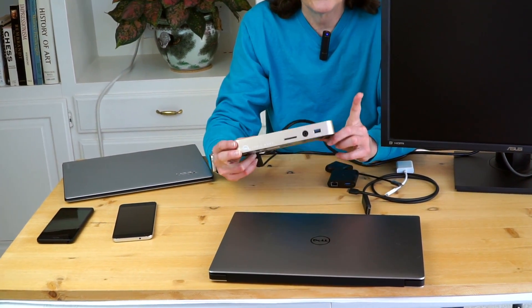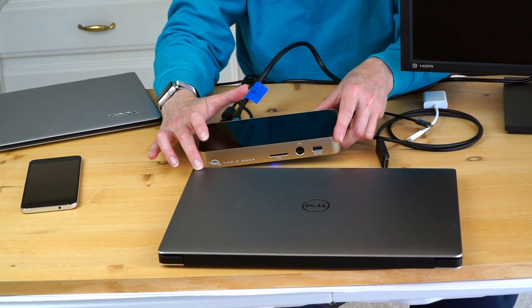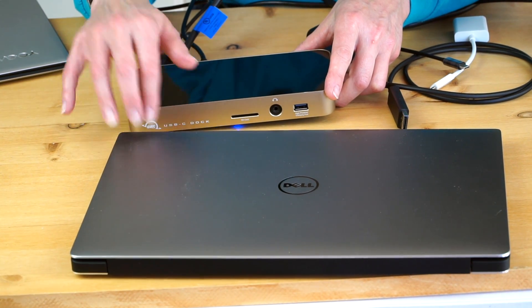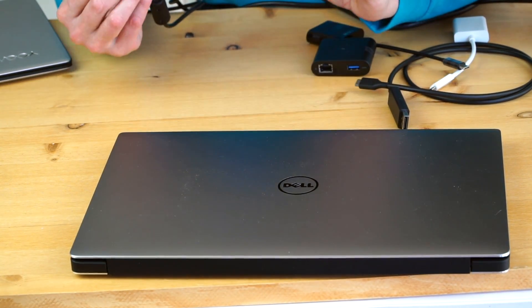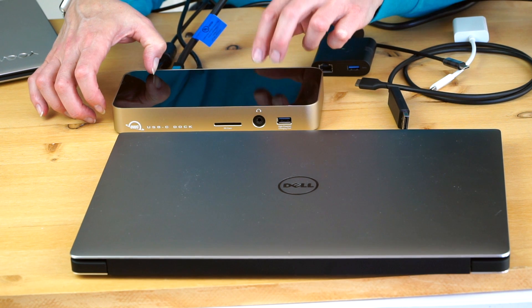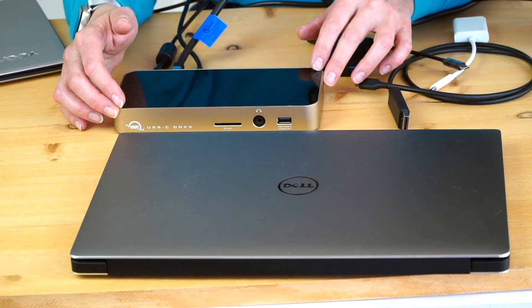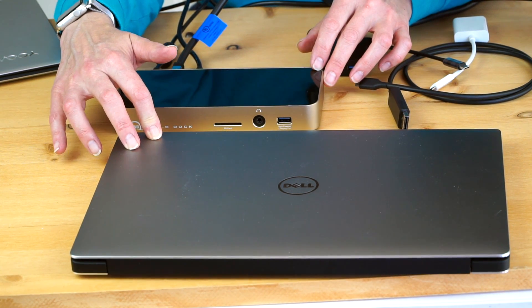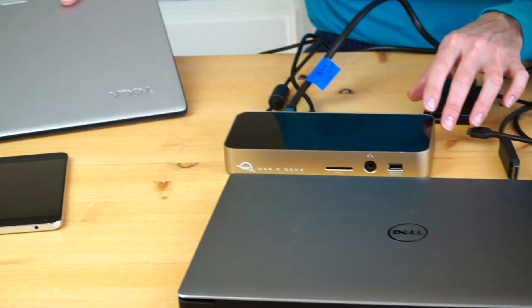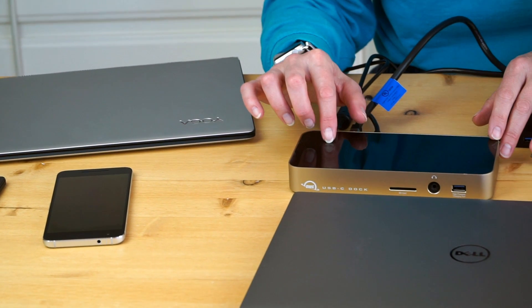This is where the complexities arise with something that should be a universal standard. USB 3.1 Gen 1 and Gen 2 aren't always so universal, and then you throw in Thunderbolt 3 and it all gets confusing. We tested the dock with the Dell and it actually charged the Dell. The XPS 15 warned it wasn't getting enough power — that's because it wants 120 watts, while this charger is 80 watts and the USB-C maximum is 100 watts. The Lenovo Yoga didn't do anything at all. So don't buy this if you want to use it with Windows machines right now.